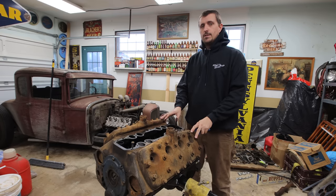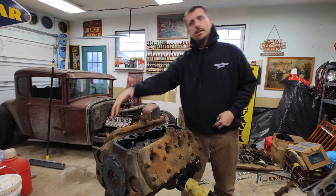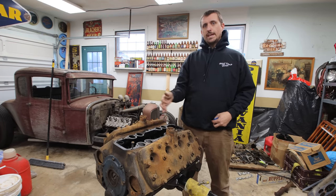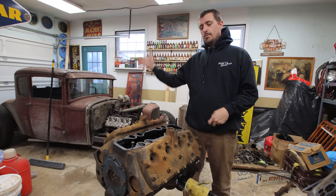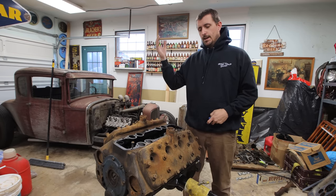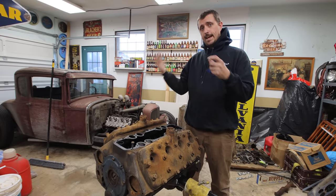So today, it has a fiber timing gear in the front that is broken. So I need to pull the cam to replace it because it is a press-on style. So changing the cam, I might as well put an aftermarket cam in it, some adjustable lifters, and have a little bit of thump. So to do that, I gotta take the heads off.